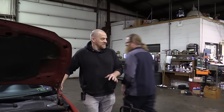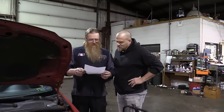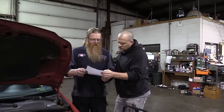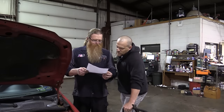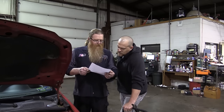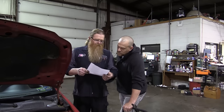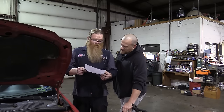Give me the brief rundown. Recently replaced the motor — rebuilt engine has about 70 miles on it. 2007 Suzuki SX4. Things replaced with the motor: spark plugs, coil packs, new fuel injectors, new seals, new intake manifold, exhaust manifold gaskets, new converter, upstream and downstream sensors. MAP was replaced two years ago when the original one failed. New camshaft, new crank sensor, new purge valve.